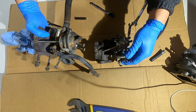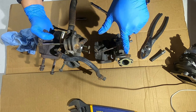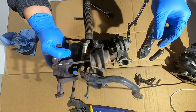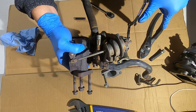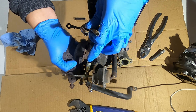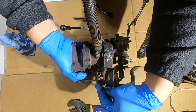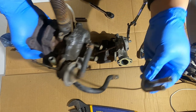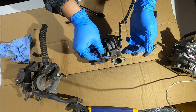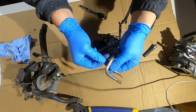For K-car people, these water pipes are different between the VZ25 and VZ24. The two coolant lines go this way on the Alto Works, Suzuki Kara, and AutoZam AZ1. The Cappuccino has one going down and one going to the left — different than this. The nipples are also noticeably bigger. It's probably for clearance of something, though with soft lines you could bend them however you like.